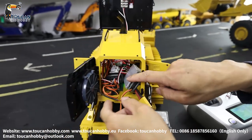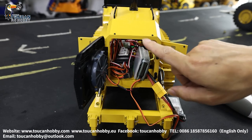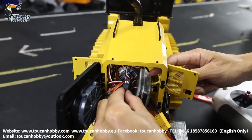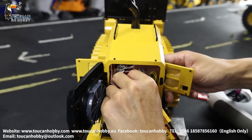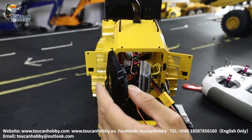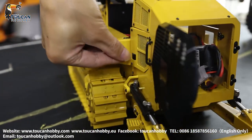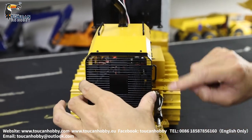Now we can plug back the fan and the ripper plug. Arrange the soundboard and the receiver back to a good position and put all wires secured with clips. Put back the signal wire, put back to channel 10. Fan is now also working. All plugs back and secured with the tabs. Close the cover. Lock this side also. Be careful — only close this one, then you can operate hydraulically; otherwise it will damage the cover.